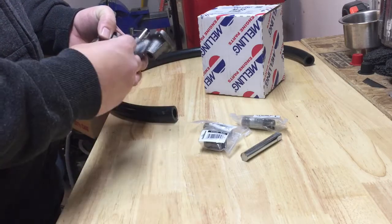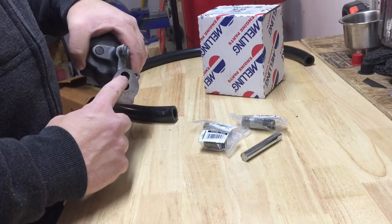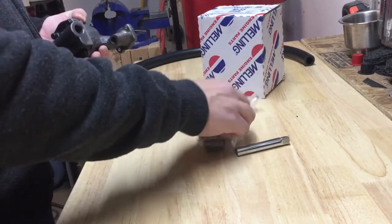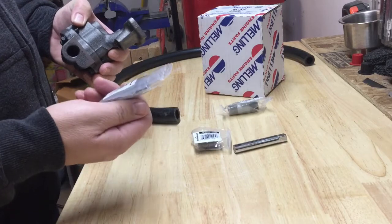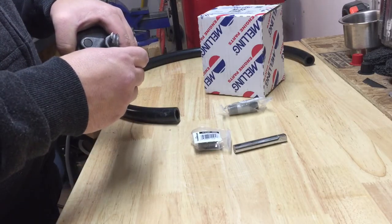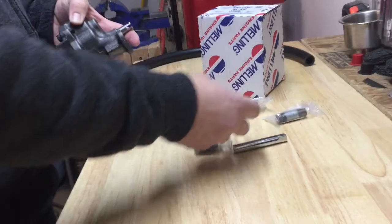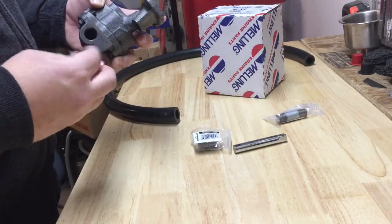This is your inlet — usually you have your sump strainer that goes to your oil pan — and this is where the pressure out is. We're gonna take a quarter inch pipe nipple, thread this quarter NPT, put that in there, and then attach a hose on it. That's gonna go over and fill our oil jugs.